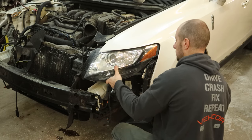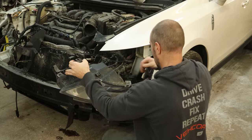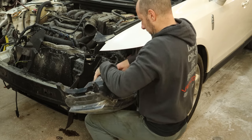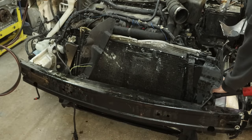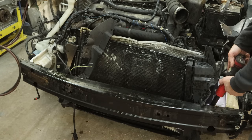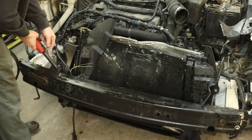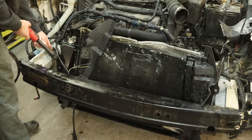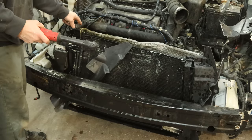We'll go over to the corner of the shop to take it apart because it's not going to drive in a minute. We're going to unplug our headlight — this plug is broken; it was crushed from the last time somebody was there. That front bumper reinforcement has also been replaced at one time — it's supposed to be welded on but they never welded it back on, and it's supposed to be painted but they clearly didn't paint it either. Now we're going to remove the lower section of our multi-piece radiator support — it's not supposed to be multi-piece. This radiator support mounting bracket on the rail is pretty twisted up, probably going to have to replace it. There's also one bracket for the fender that was not only mangled but torn in half.